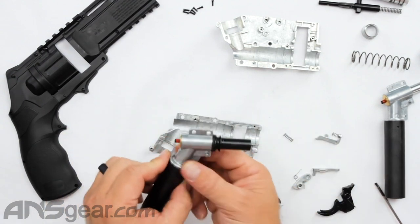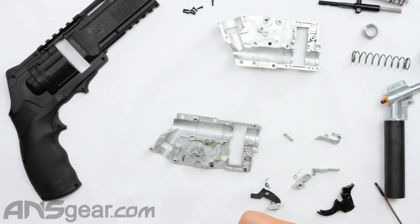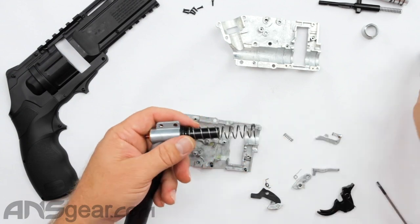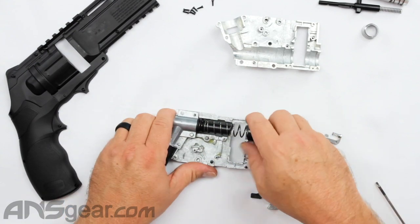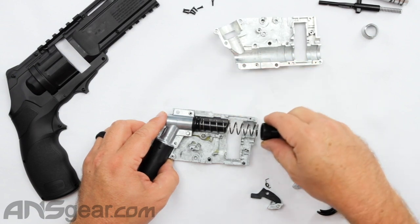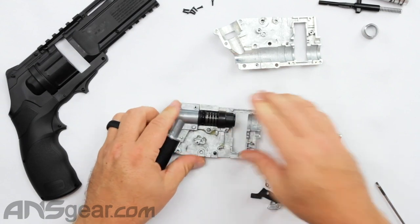So we've got this out now. This is our basic, normal valve. We're going to remove two pieces — the bolt and the bumper — off of this one and set it to the side. We won't need that anymore. Here's our new valve. We'll put our bumper and bolt on there. We've got our spring and our guide at the front right there. We're going to take this new one, set it down in there. We're going to compress this all the way down to this depth right here. Compress that down and set it down in there, pushing it all in so it doesn't want to come apart.